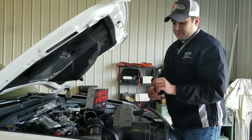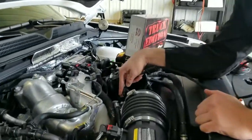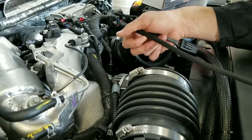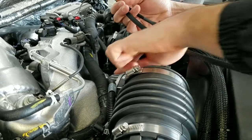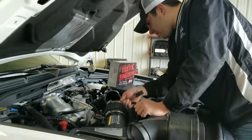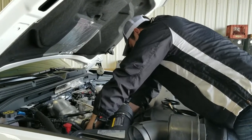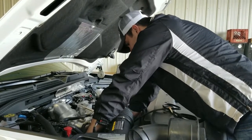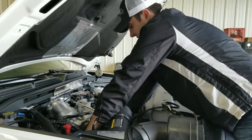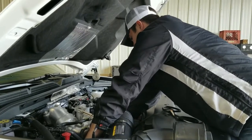We will go ahead and route the female portion of our harness down through the alternator and the intercooler housing, following the path of the factory wiring harnesses running through here. Once we finish this install, we can zip tie our harness up to those factory locations to keep it away from heat and moving components. It's very important once you get these lined up that you hear a snap — that means it is secured and in location. If you do not hear that, it's probably not fully connected.